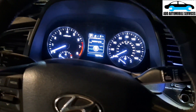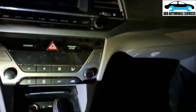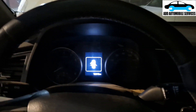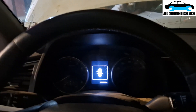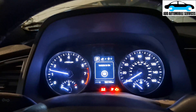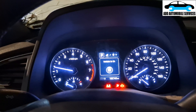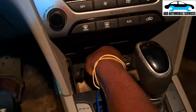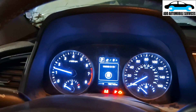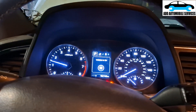What I'm going to do is supply power to the fuel pump here, then crank and let it run for a while. Now that it has good power, there is enough fuel pressure for the vehicle to run. I have the connection here — if I disconnect it, the vehicle might not run properly. So it's a power issue.